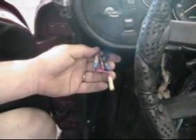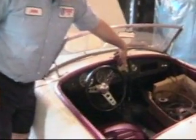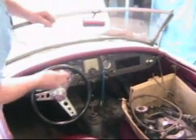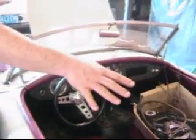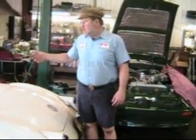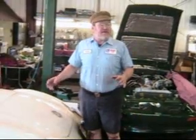Let's go over and look at an MGA and talk about where this can happen there too. On the MGA, we've got the headlight switch here, which takes power right from the battery — an unfused circuit — and puts it into the red circuit, and the red circuit goes lots of places. It goes over to the dash lamp to illuminate it when the parking lights are on, to the dash rheostat to light up the dashboard, and out to all the corners of the car: the parking light lenses, the license plate lens. For those of you who have wired an MGA, all it takes is to pull the wire incorrectly. You turn on the parking lights, and if you're not paying attention, within a couple of minutes you see smoke rolling out of your nice wiring loom, and you've completely lost the loom and have to completely rewire the car.